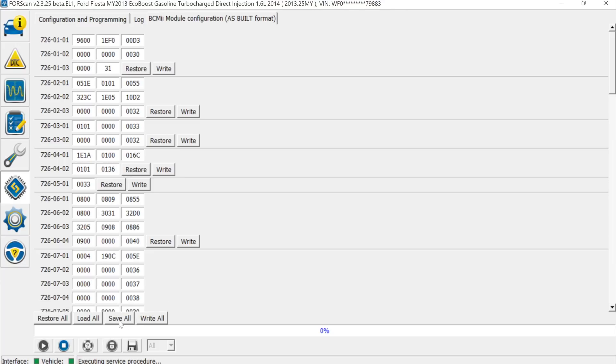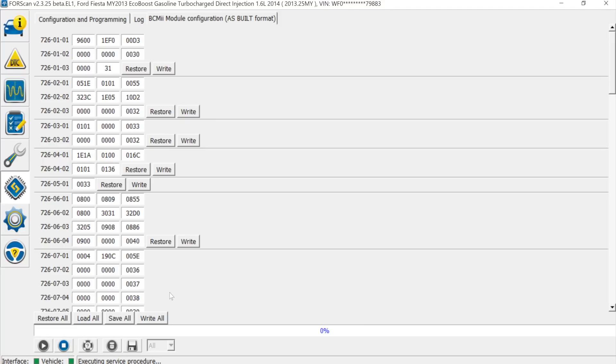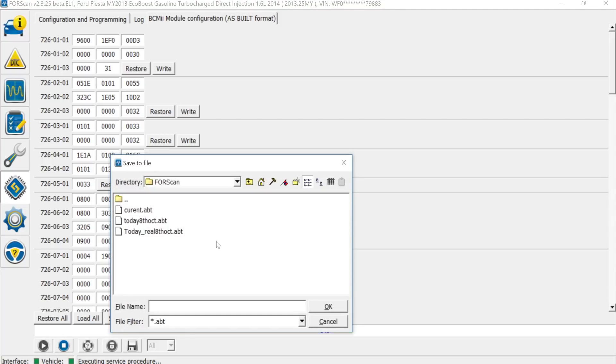There's a warning if the battery is lower, but this version will bypass that. Now it's showing all the different hexadecimal blocks — each represents a program or setting for the car, so don't change these unless you know what you're doing. To take a backup, simply click Save All. This saves the current configuration. My old BCM was damaged but the program was still fine — if it lists the hex decimals, the EEPROM holding those settings is working correctly.